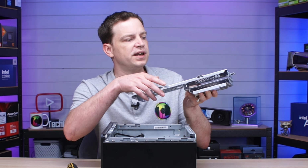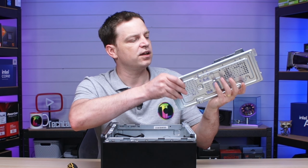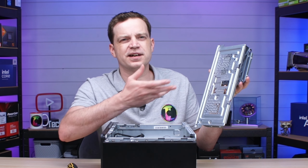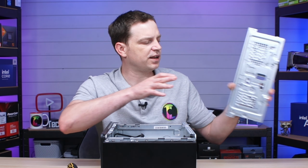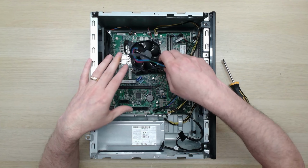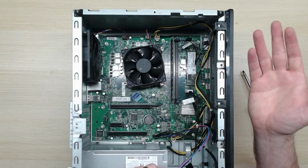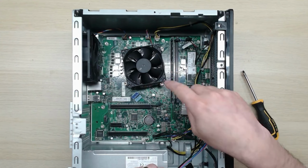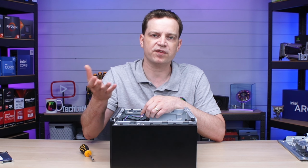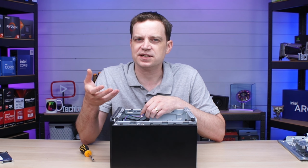You can also put in a hard drive, so there's a hard drive here. You can also put another hard drive on here, or there are markings on it where you can actually put SSDs and things like that. But like I say, this one is a little bit different. So when we look inside the system here, of course, we've got the cabling for our DVD drive. Motherboard is a pretty standard micro ATX format, although it does have an extra piece on the front which provides the USBs and things like that on the front, so it won't necessarily actually fit inside a normal case.